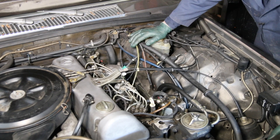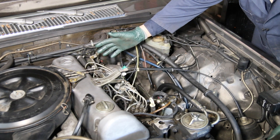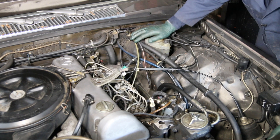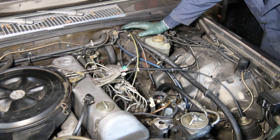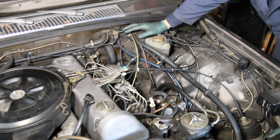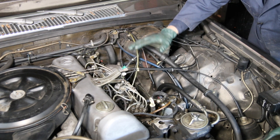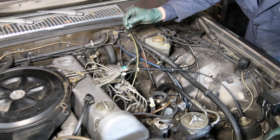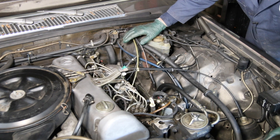It's hard to believe it's been almost 30 years and I'm still getting emails from people saying, 'I've got this old diesel, I turn the key and it doesn't shut off.' I've done so many videos on this and written manuals on this, so I'm not going to go over all the details, but you need to remember — if you're new to these old engines — the fuel shutoff is vacuum activated, it's not electrical.